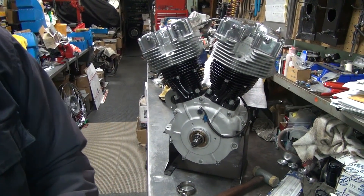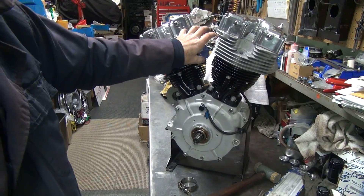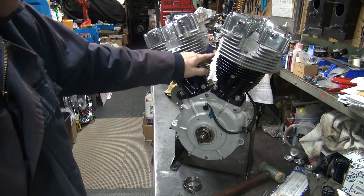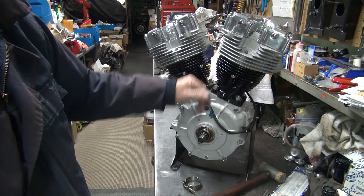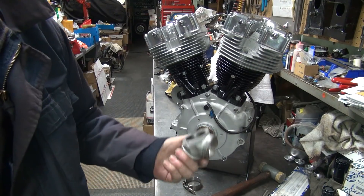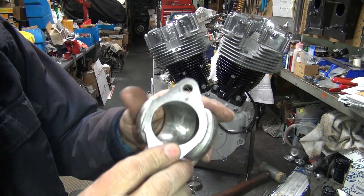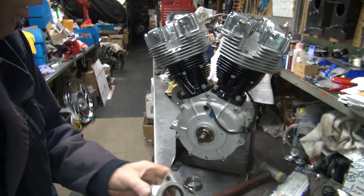You can get most of this tight with the motor mount up in here without a problem. If you have a horn or coil right here, then you've got more of a problem — you can angle them both down a little bit further and come up with a way heavy angle, and you'll clear all that stuff too. I went ahead and flattened this out while I had it off — it's all ported to match the heads. So it should work pretty good.